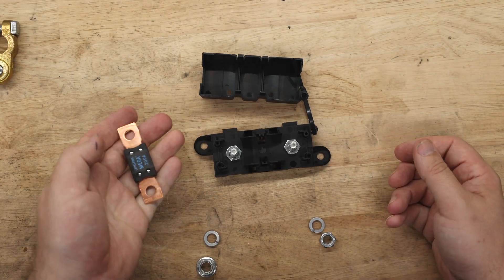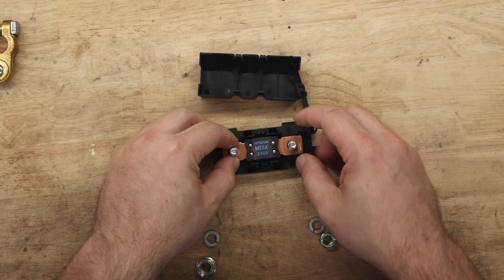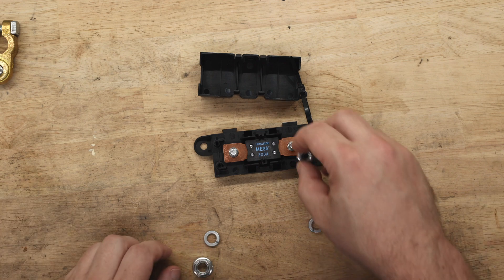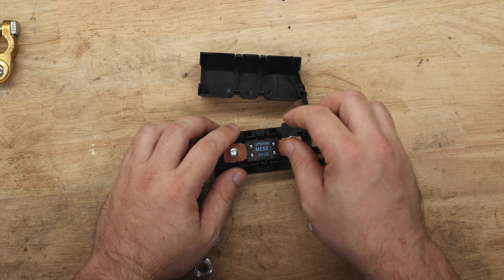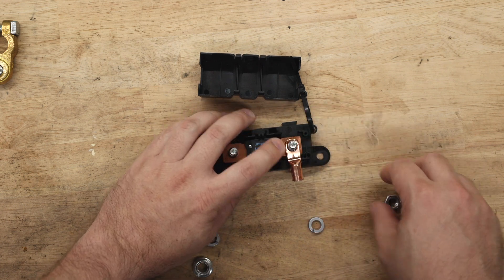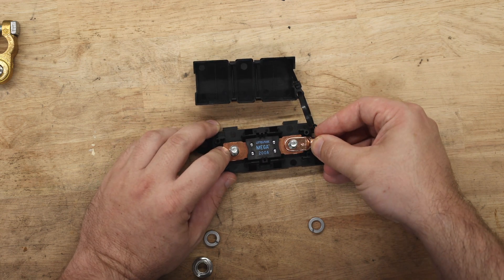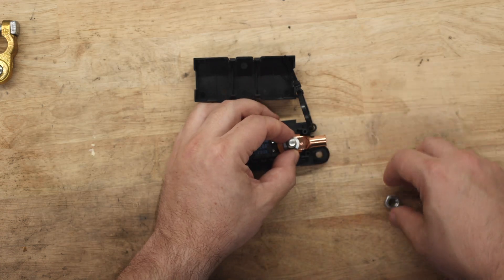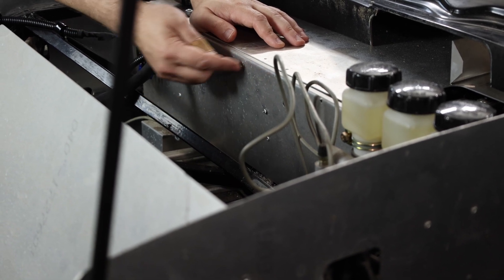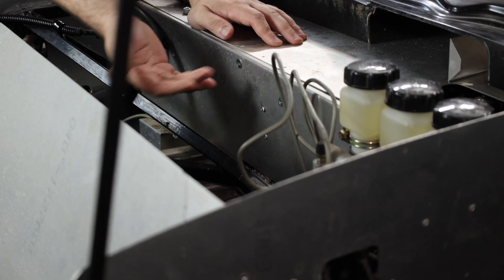Here's what the fuse block looks like without the fuse in it. We're going to take this fuse and push it directly in — you can see there are two little tabs that clip it into place. I could use these nuts to hold the fuse in place and then put the battery terminals on top with another nut, or I can just use the terminals, put them in place, and use the nut on top. I'm going to use the terminal itself and then put the lock washer and nut on top. For both mounting points we're going to use riv-nuts — one going directly into the chassis for a strong pull. This is where the fuse is going to mount.